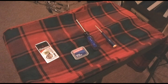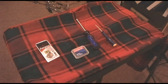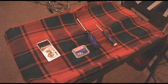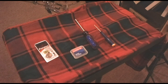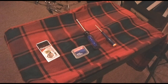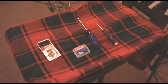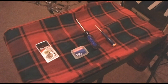Here are the materials you will need to replace the battery. One Phillips screwdriver — make sure it is a good one with sharp, no dulled edges. One tiny flat head screwdriver, which will be used to pry the backing plate open after all the screws are removed. One CR2032 3V battery — you can find these at Home Depot or really any store in the battery section. Watches and car remotes use these as well, so they are really easy to find. Buy a good brand battery though, or else you will be replacing it more frequently.